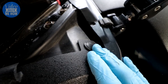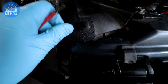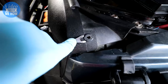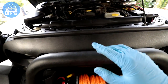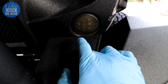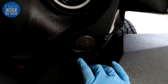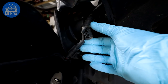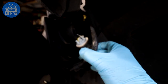Next step is to remove those. Once they're all out the grille should pretty much come away — but wait, before you do anything make sure you disconnect your indicators down the bottom, because if you try and rip out the whole grille you're gonna take them with it and cause all sorts of dramas with the wires. Go around behind and disconnect — it should be as simple as twisting it around far enough to pull out the wiring.